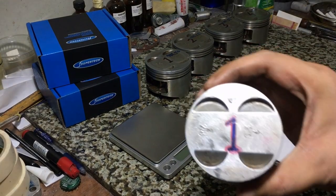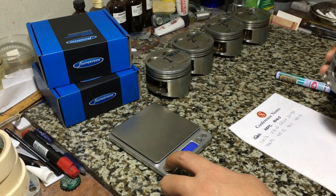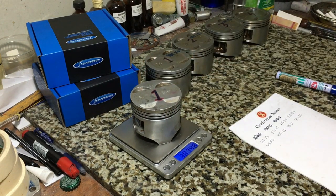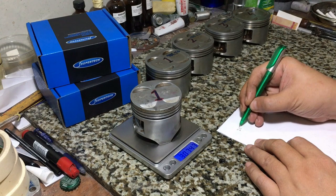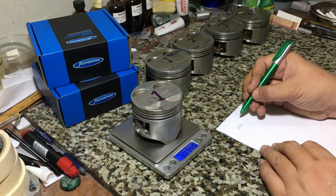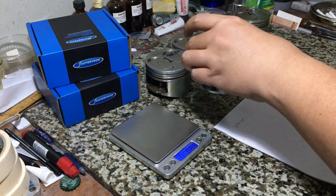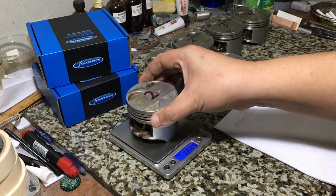Here we are showcasing a set of PM3 pistons that is stock from a D15B7. They are flat tops, and we've heard that some people use it on a D16 to gain more compression, but you gotta be aware, it sticks out above deck, so just make sure your clearances are good, so it's safe. But if it's not, you might bend a valve or two. We've actually set this in a balance a long time ago, so it's ready to roll. But we're just keeping it on the shelf just in case.